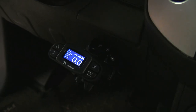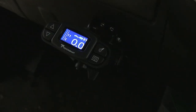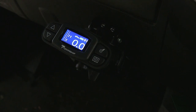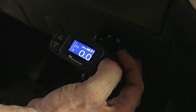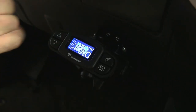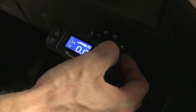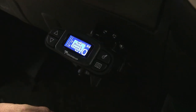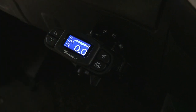This is what the P3 brake controller looks like when it's installed in our Nissan. We have three settings here that correspond to the size trailer or how much weight you're pulling behind your truck. B1 for a small conventional truck and trailer. We hit this button here, we get boost level two, and you see how the icon changes to like a little fifth wheel. Boost level three, and it turns into a really big fifth wheel or gooseneck trailer.